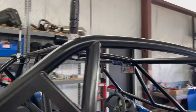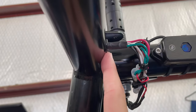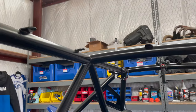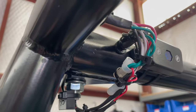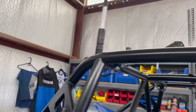This side is slightly more complicated because it's actually three ways. So there's wire coming, this is actually coming from the switch pro. And then it comes out, crimps to these three endpoints, like we talked about. And then it actually goes back in the cage and runs down that bar to the other side. So we have twice as many of these 16 gauge wires that are just paralleled with all the others. So same type of deal. What I'm going to do now is just put some loom around that wire.